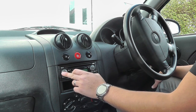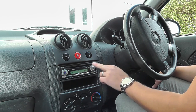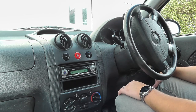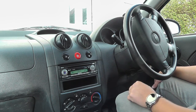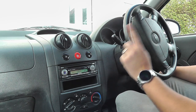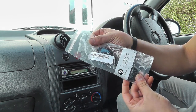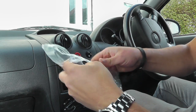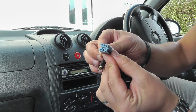If you press source you've got CD, AUX, and radio — three options. I noticed the AUX option, but when I took the stereo out there was no AUX plug in the back. However, I did find a connector on the back and it turns out you can get this cable here. It says Volkswagen on it, so I'm guessing it's all the same — it's got a plug that will turn it into AUX.